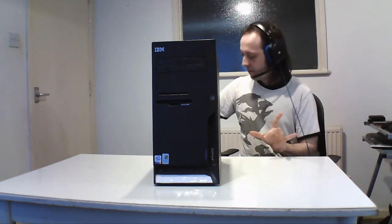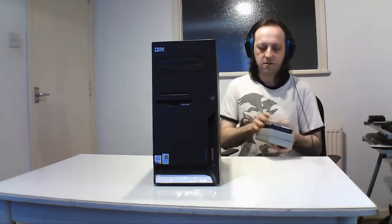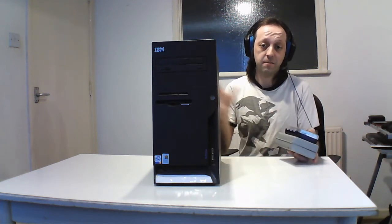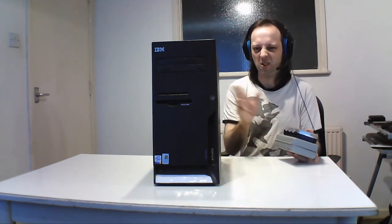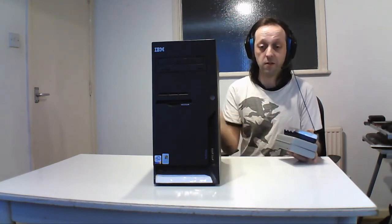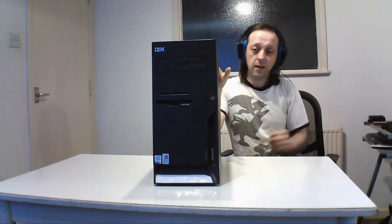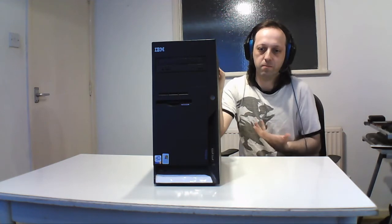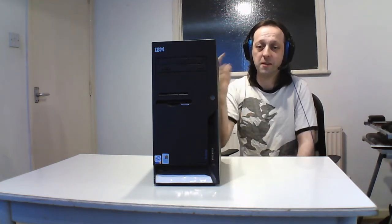And generally, the tools are a general thing. I use 2 tool kits here. You can go online, like iFixit, for tools specific to what you need, but I use this stuff. I've got a security kit for odd things that have security screws, and the general tool kit which I use for everything. They're all magnetic, which is good for a PC, because you can use magnetic tips. The only time you couldn't use magnetic tips was for floppy stuff because floppies are magnetic media, but not many machines have them anymore, and it's only around the floppy bay. I still use it on this machine with a floppy, because it's only the media itself that can be affected. But I don't think you can damage the floppy drive.